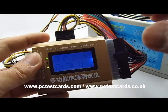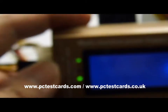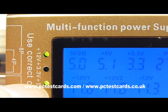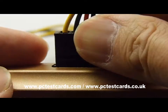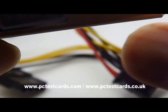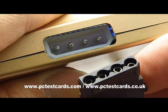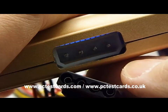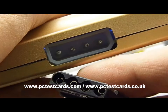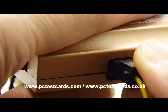Now we check the LEDs — both 12V and 5V are on, which indicates working SATA power connectors. We will do the same to test the standard IDE power connectors. The IDE connector is easier because the cutouts at the corners help us determine which way is up — the wrong orientation simply won't work.